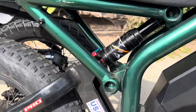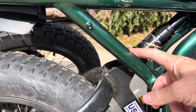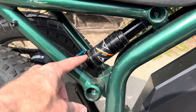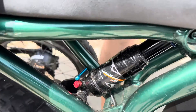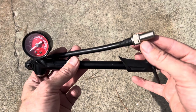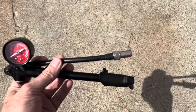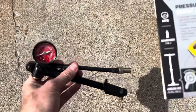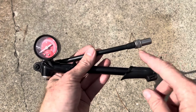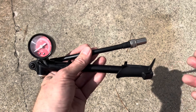First you're going to need a shock pump and you need to get to the air valve. On this bike the air valve is obstructed by this support, but the workaround is I can sit on the bike and it moves the shock down so I can get a pump on it. A lot of shock pumps have a straight nozzle, which is a problem on e-bikes. I'm going to use an adapter to get 90 degrees around the corner. If you don't already have a shock pump, I'll put a link in the description to one that has a 90-degree end — that's much better for the tight fit on an e-bike.